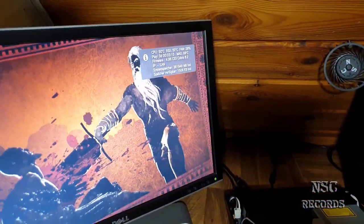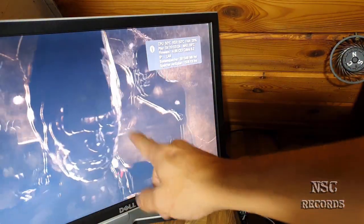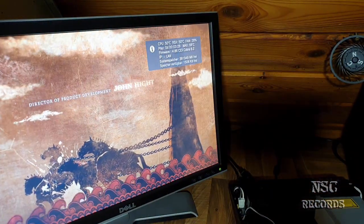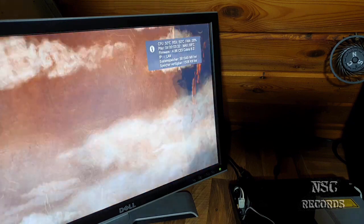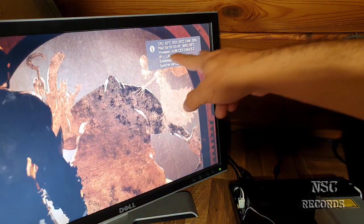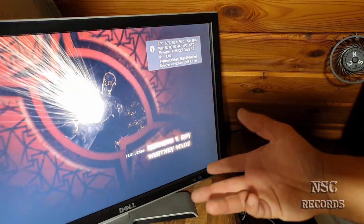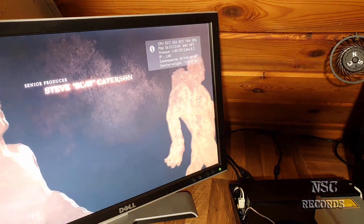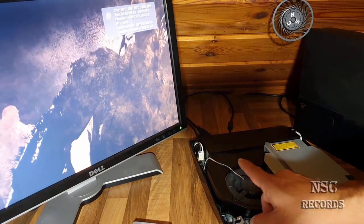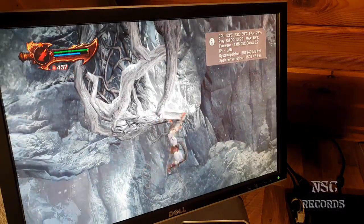So that means if I would remove the heat spreaders here right now, I can tell you one thing, guys, the thermal paste inside the heat spreaders here will look very great. And that's why I have not removed it now, because it's not needed yet. Nice. And now I have just applied some great MX4, included a great application like Webman mod, and a faster turning fan speed, of course. It will just last for a very, very long time, guys. Okay, so this one here was the CECH2500. With a PlayStation like this, you can play 1 week without pause.